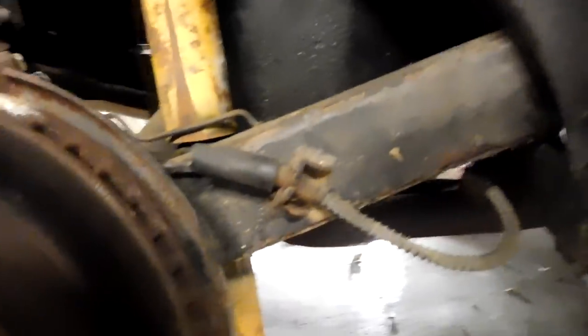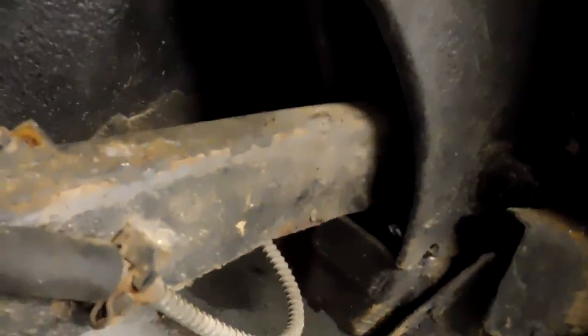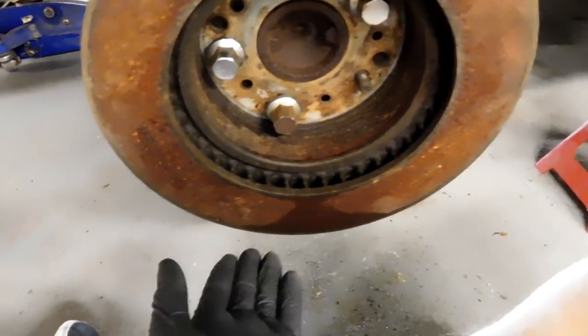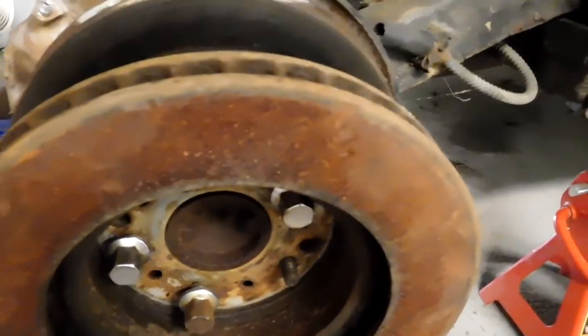The reason I do this with the car on jack stands and with the wheel off is because there are a couple things on these suspensions that can give you a false positive. The first is the bushing in the very front of the trailing arm — if that's worn or you're missing some shims, the movement of the arm side to side can simulate a bad bearing when it's not. Also, these strut rods that go side to side can go bad, and you can have movement in and out that will also simulate a bad bearing when there really isn't one.